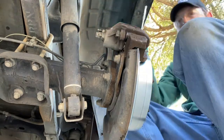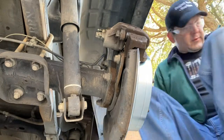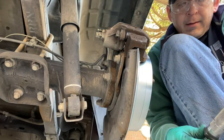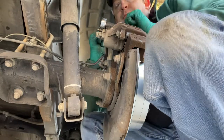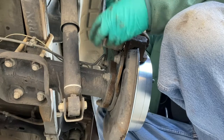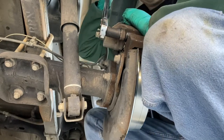Double-check the rubber boots — make sure nothing looks kinked or unusual. These look good. Get your torque wrench out and dial it down to 65 foot-pounds for the caliper slider pins. Torque both pins down and take a peek to confirm everything looks correct.